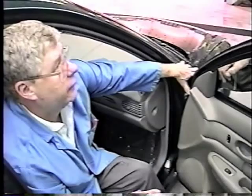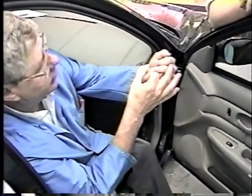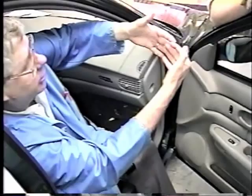Or you turn around and say, well, let me manage the water. So you take the bottom baffle, which is sealed, and you put a little chiclet in there. It's like a little plug that causes the expandable to come back a little bit, creates a little funnel hole, and it'll go out.